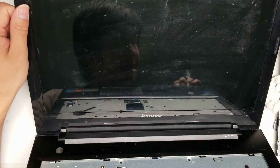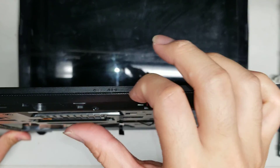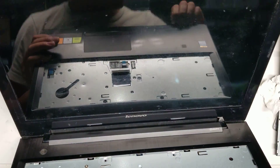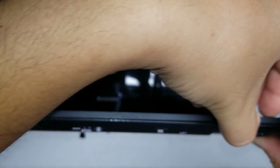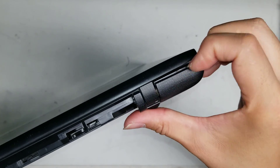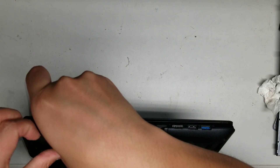After you get all of that done, slide it forward. Underneath, between the front and the bottom panel, there's a gap — that's where you pry. It's easier to start from the back here; you can see I already pulled it up and there's a gap. As you pull that up, you can see it's popping out. Do this while the screen is open because the keyboard layer will actually come up separately.